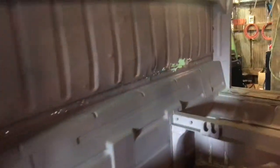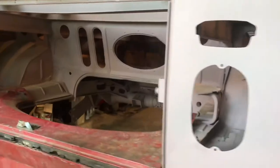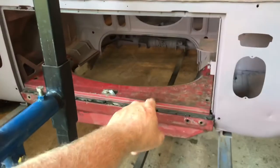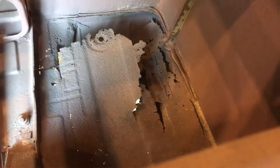You can see back there it's all rusted out and beat to pieces. The floor he's stripped out — treasure chest floor, what's left of it, he's stripped out. Under here there's a few pinholes towards the sides, but the main frame is fairly solid. I don't think this is original — I think he bought it at a swap meet, but I'm guessing it's the same year; it's got '68 stampings on it. But the battery tray, of course, it's gone — they're always gone. I've got a new one of those. It's solid here; normally they blow out right where that battery tray is, but it's pretty solid right here. That'll be a little less work.